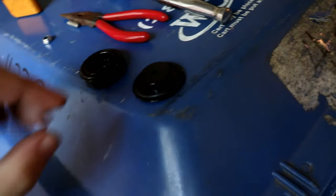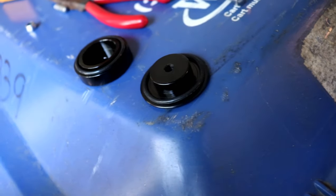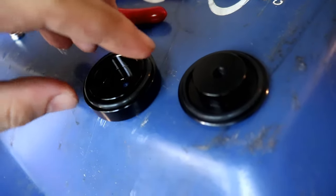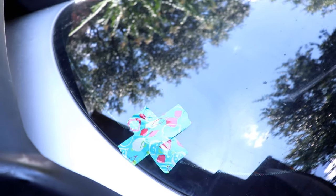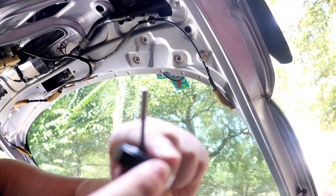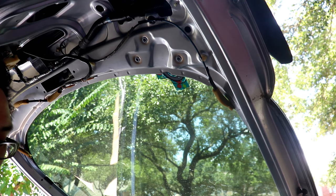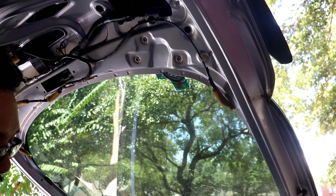I got that disconnected. All I gotta do now is move this washer and this rubber grommet. So here's how it works: this flat part goes on top, which is the outside of the window, after a rubber gasket seal. The other piece goes under it with also a rubber gasket seal and a screw to tighten it all down. It might help to put a piece of tape on the outside part while you work on the inside to keep it from moving. This little screw takes a 2.5 millimeter allen key, and the nut it comes with is a 10mm, FYI.